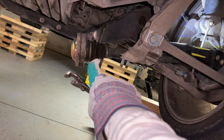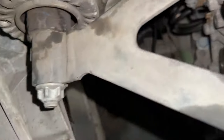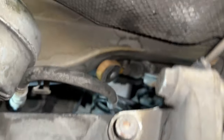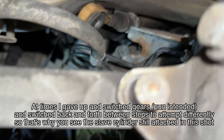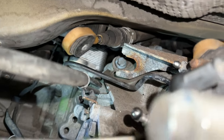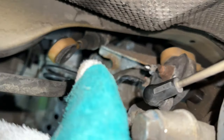The biggest pro tip is dropping this axle. I recommend nice fat gloves. Upon using this grip tool, both of the brackets momentarily broke off of the shift cable, but it was still difficult to remove — though not as impossible. At times I gave up and switched back and forth between steps to attempt differently. That's why you might see the slave cylinder still attached in the shot. With the shifter cable out of the way, I can actually begin to reach — not the bolt immediately next to it, but the bolt up there.